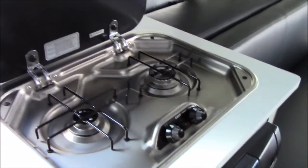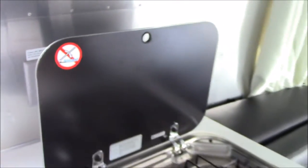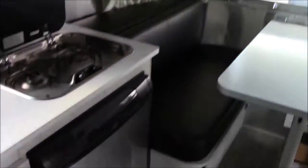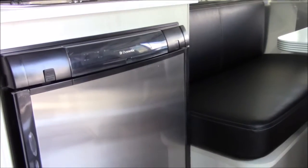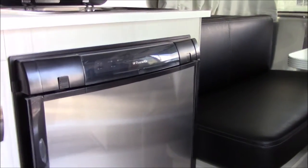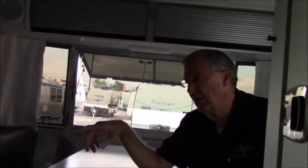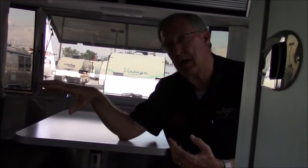That's the main reason I left that propane tank open out front - I'll shut that off when we're done here. Also, let this cool down before you close this glass lid. Your refrigerator - this is a two-way refrigerator, it's 110 or propane. When you're going down the road, run it on propane - that's perfectly fine. When you're plugged in, it's going to run on 110, so why waste your propane if you've got electric there? There's a setting where you can put it on auto - it will be running on propane, you plug in, it will automatically switch. You unplug it, it will automatically go back to propane. To open and close this thing, there's a safety latch - grab it here and press very firmly right here with your thumb to unlatch it. That's a safety catch so it doesn't pop open going down the road. Everything I'm going to tell you about how to run this refrigerator is right down here on this label.